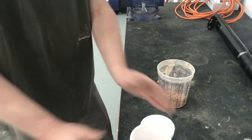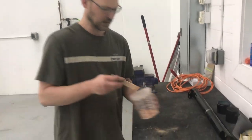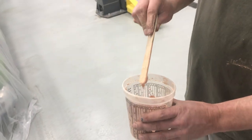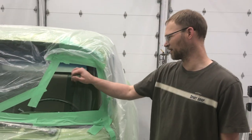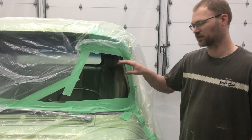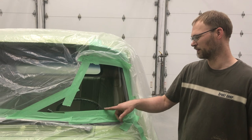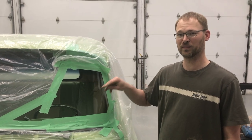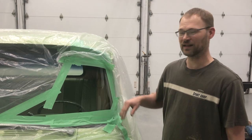About the consistency of toothpaste — you don't want it really runny because you want it to not fly off. You want it to be kind of thick, just a little slurry. The scratch is deep so it won't go all the way away, but we can try and polish it out as best as possible and make it less noticeable. You have to go really slow. If it's a modern glass, there's a transparent film inside the laminate, and if you overheat the area it will warp the film between the two laminates and ruin the windshield — it'll leave a blurry spot. So slow, and keeping the heat out of it, is the way to do it.